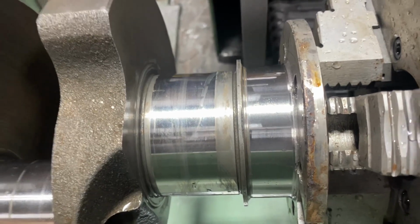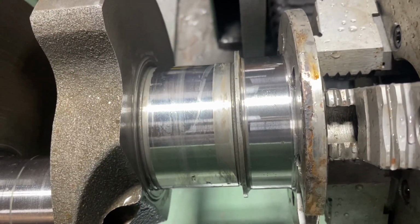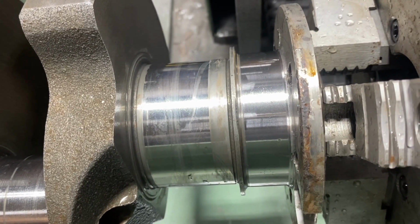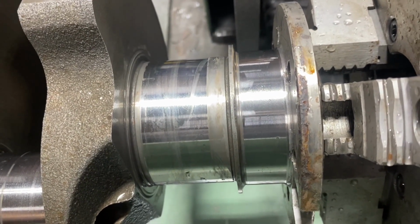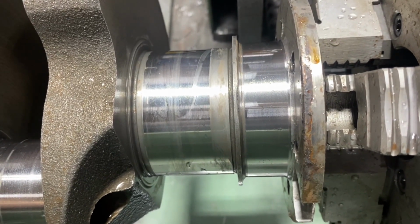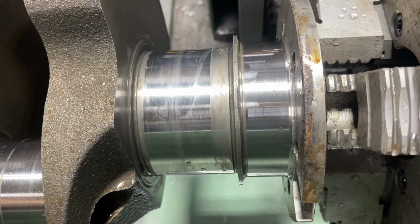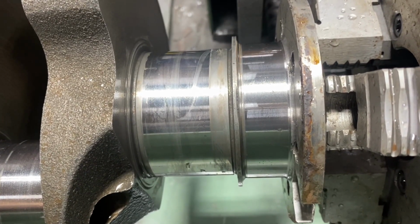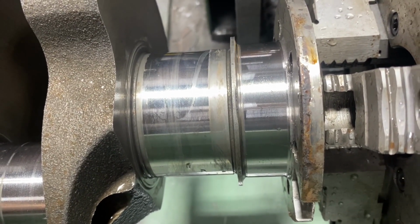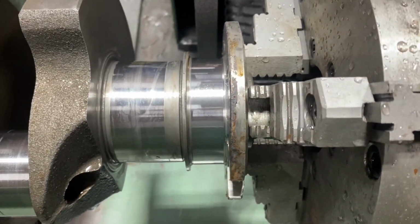The 440s, there's a new seal out now from Fast Fish Auto Parts that you could use both directions, which I have successfully. It's a one-piece design. There's a video on my page showing you how to use that as well. So you can cut the knurl off and run that either direction, because that seal doesn't have serration. But 318s right now, we don't have a solution for opposite rotation right hand. But like I said, this 360, we can use that Felpro rubber seal now and shouldn't leak.